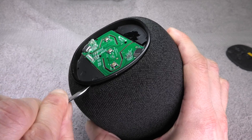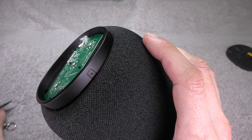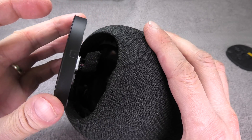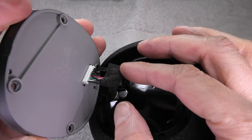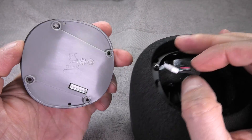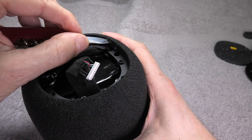With a little prying tool we can detach the top plastic piece relatively easily. Just remember that it is connected with a little harness — you can see this little plug on the bottom — so carefully unplug that. Now we can have a first look at the inside of the speaker, but we're not quite there yet.